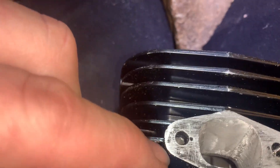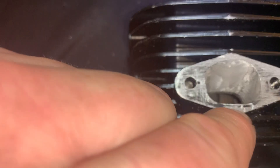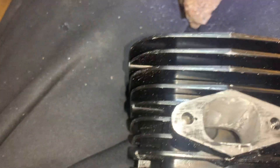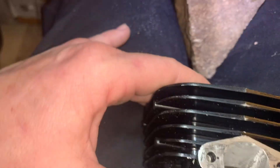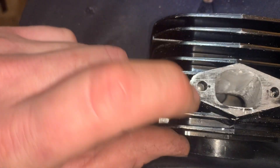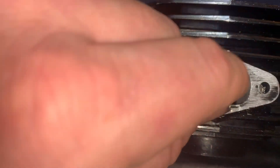You can see I just did a couple passes. This was all painted from the factory but you see here — it didn't even touch it. You see the dimpling, the low spots. I just did literally four or five passes just to scuff the surface and see what it looks like, so you could see how bad the surface is before I even try to mat it up with the gasket. The gasket is going to crush slightly, but I want the best seal I can get — so there's no chance of leaks. This is obviously the intake side. Look at the black here — the dimpling, the black is deep. I'd rather have a perfectly running motor. I just wanted to give you guys a little heads up on how bad this actually is from the factory.